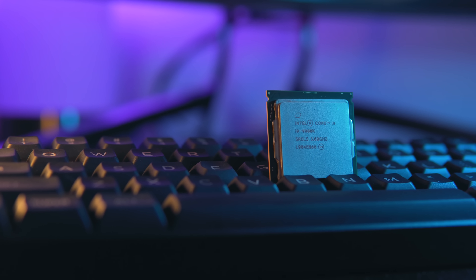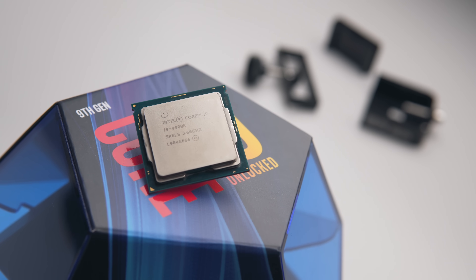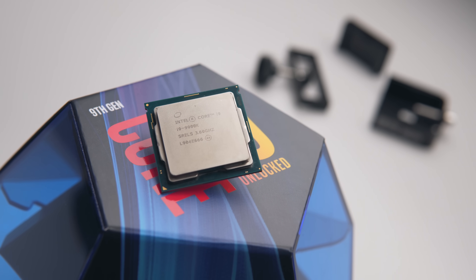That result is partly due to testing at 5 gigahertz at 1.35 volts. If you're running your CPU at 1.2 volts, for example, you're not going to see as much of a drop because you're not pushing as much power — definitely something to keep in mind. If you are interested in doing this, I'll leave links to all the tools you'll need down below in the description. Thanks for watching and I'll see you in the next one.